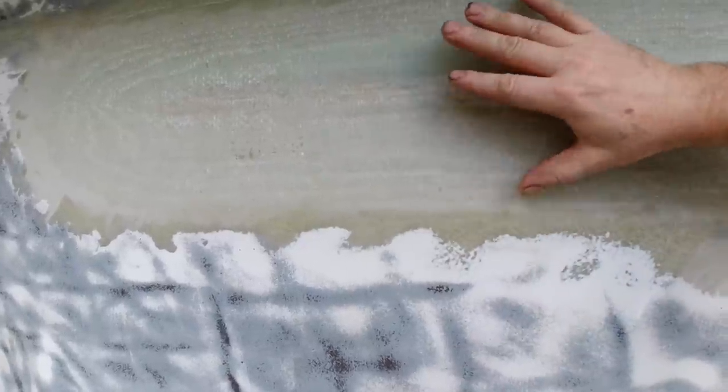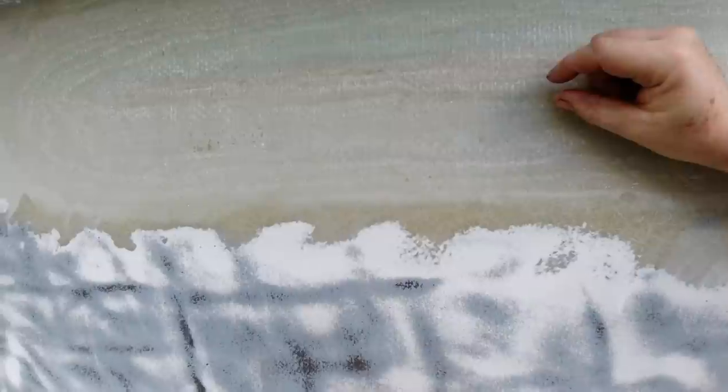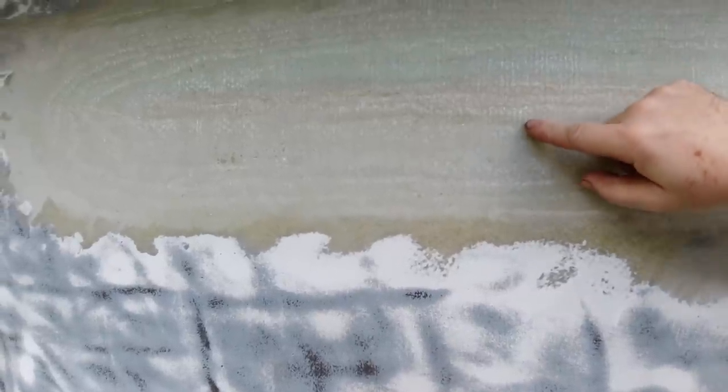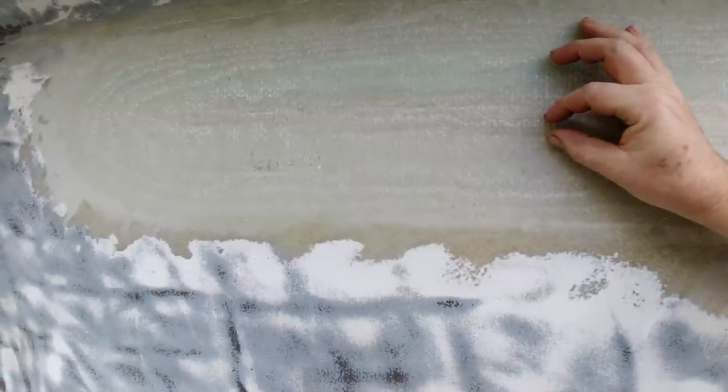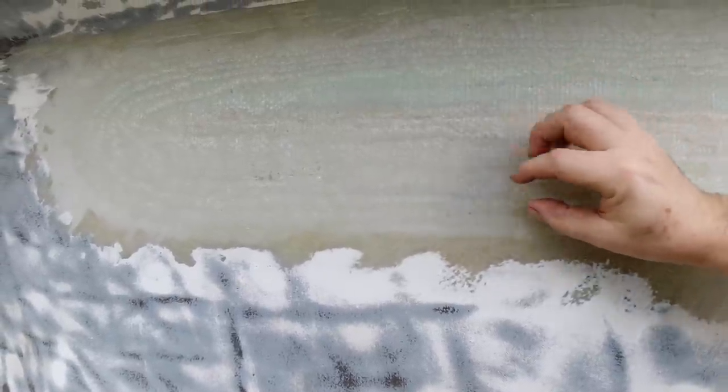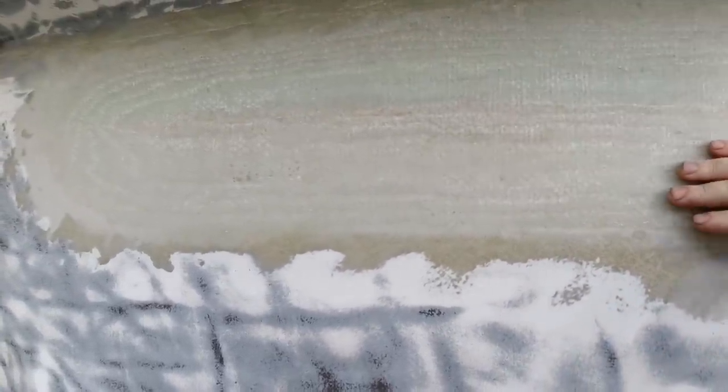You want this to be straight, not dished, and it's a little bit hard to do that with a grinder. So I come back and fix it up with my belt sander, and that makes a nice smooth transition. I'm going to go a little bit wider. For the optimal bond, based on this being about 30 to 35-40 thousandths thick, multiplied by 12, that puts it at about a half inch or four tenths of an inch. So I need about between a third and a half inch between each layer to get a good bond. Then we should be good — I'll make this a little bit wider and we'll get some glass on this.